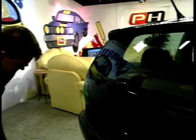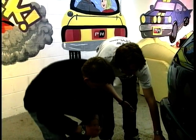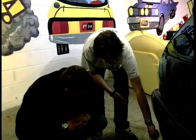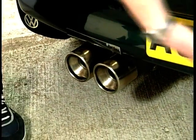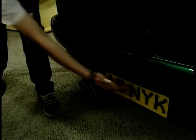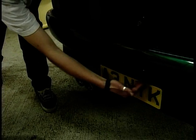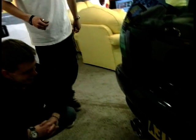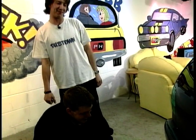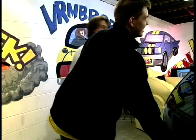The badge has been taken out on the number plate and filled — smooth tailgate. As far as I know, there's only one other Polo in England with a smooth tailgate, and it's the same colour with the same lights. I did this quite a while ago — I've set a trend there. And a huge twin exhaust down at the bottom — that's Jetex, imported from Germany. It's got a really good tone. And I made this little Perspex thing for the number plate width myself — I've moved the lights from there to underneath. They're actually Fiat Panda number plate lights in there. The Panda had to come in useful for something one day.